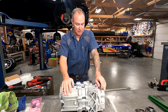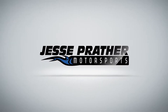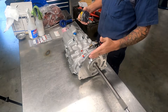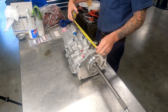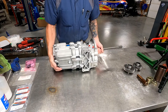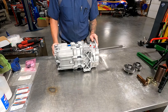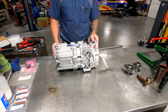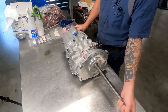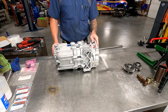So a couple of things that are interesting on these transmissions — let's get a little closer look. These transmissions are pretty tidy, pretty small. Obviously there's a bell housing that goes on here, and the transmission is set pretty far back in the car. But this is only 16.5 inches from the front flange to the back flange. And honestly, it doesn't weigh any more than your standard Miata transmission. The difference is this is a lot more expensive for starters because it'll hold up to about 1,000 horsepower — really nice high performance case, all magnesium, super light. The gears are all really light. It's just really designed well.